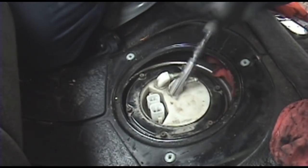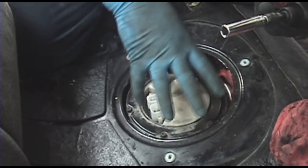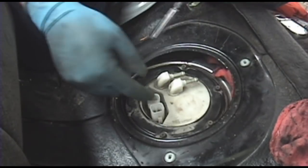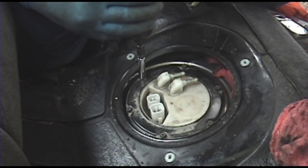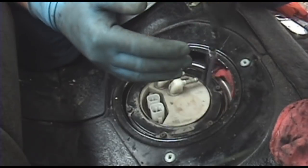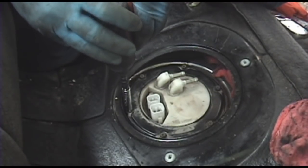Of course, that time was on an APS turbo kit for the Z. They mount a whole regulator or something up here, and it comes with longer bolts, and if you install those bolts all the way without that regulator and bracket in place, it punctures the hell out of the tank. And that's not something you can fix very easily.